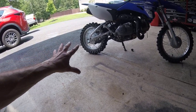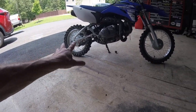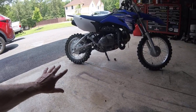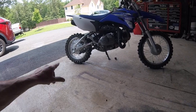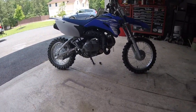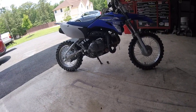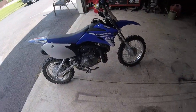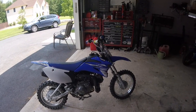So I let the air back out to where I normally keep it, and I normally keep it around 11 or 12, both ends. And I know that sounds kind of soft for an adult riding a little pit bike, and like I said, I'm like 160, 165, but that is the best air pressure for this bike. And all bikes are a little bit different, but it's just the thought of how important air pressure is, and it's a variable that most people don't give any consideration to.